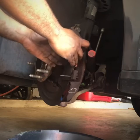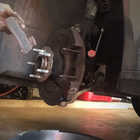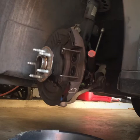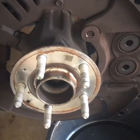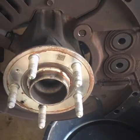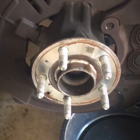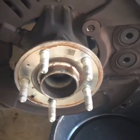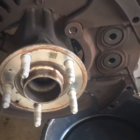Voila. Both calipers are pretty much pushed back in on both sides. As you can see, this is the old brake pad — not a lot of life left. It wasn't down metal to metal but definitely worn, and that's where I was getting all my squealing sounds from. That's going to wrap up this portion. Installation is the reverse of removal. I'm going to tighten those caliper brackets back up. Keep in mind the tools you're going to need: 7/8 on a half-inch drive, 11 6-point, and a T30 star to do this whole job. By using my flathead, both pistons are pushed all the way back in on both sides — it'll only take about 5 minutes to put it back together.